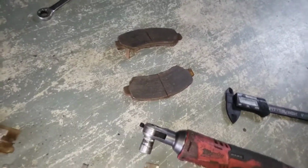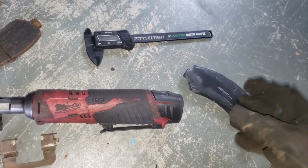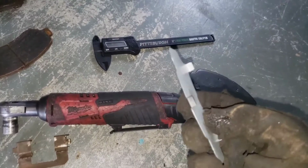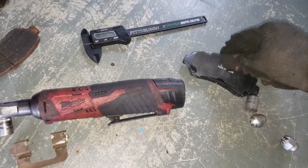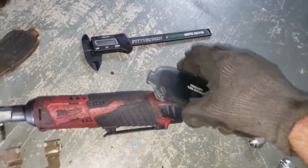Okay guys, and to put your pads back on, 2 quick tips here. Sometimes this little silence pad, plate I mean, falls right off. What you can do is take these little tabs and bend the tab in just a little bit, and that'll help it grab on better. So now I'll line them up there and snap them on, and now it's not falling off.